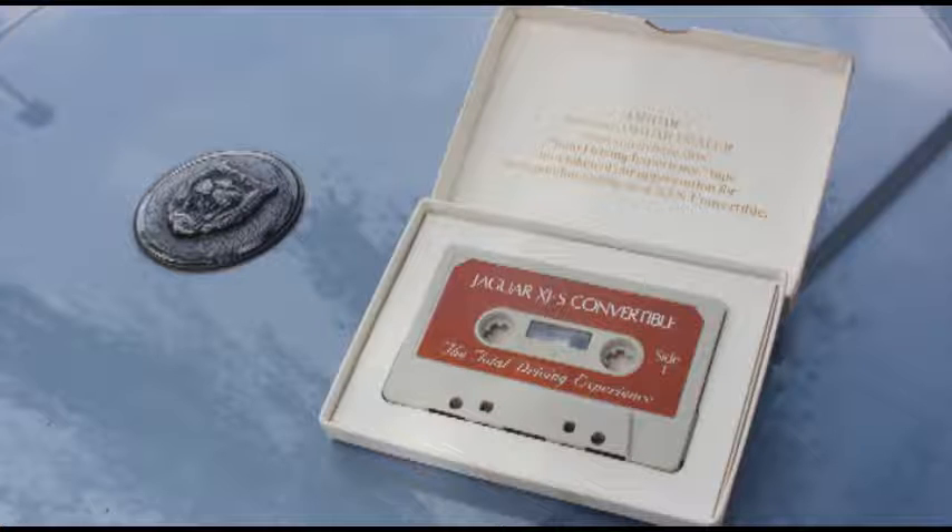To maintain the quality of your tape system, Jaguar has provided a tape player cleaning kit. After about 15 hours of tape use, an audible tone will sound and the letters CLN will appear in the upper right of the frequency display to indicate that the tape heads should be cleaned. Pressing the control marked EJ ejects the tape. To protect tape heads and cassettes, tapes are automatically ejected when the ignition or the player are turned off.